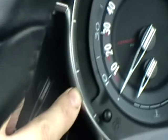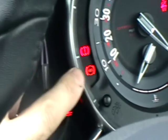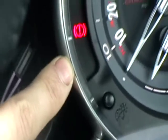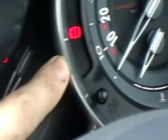How would you know if there was a problem with your anti-lock braking system or ABS? When you turn on the ignition for the first time, the ABS light will illuminate. If that light stays on, there is a problem with it. If the light goes out, the ABS is fine. If the light does stay on, you must take your car to a garage.